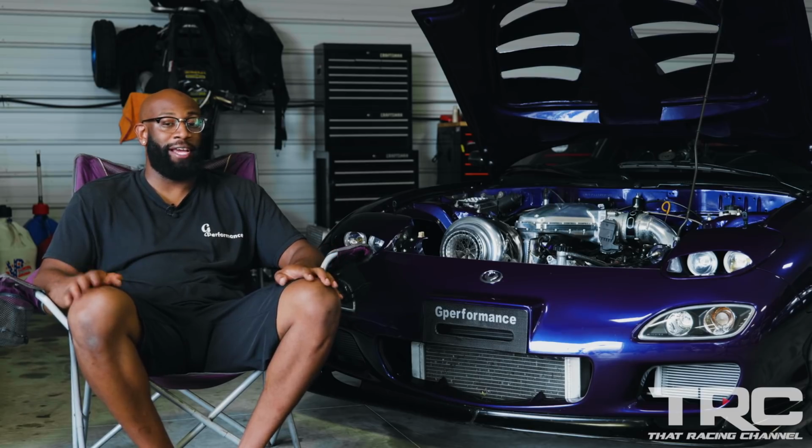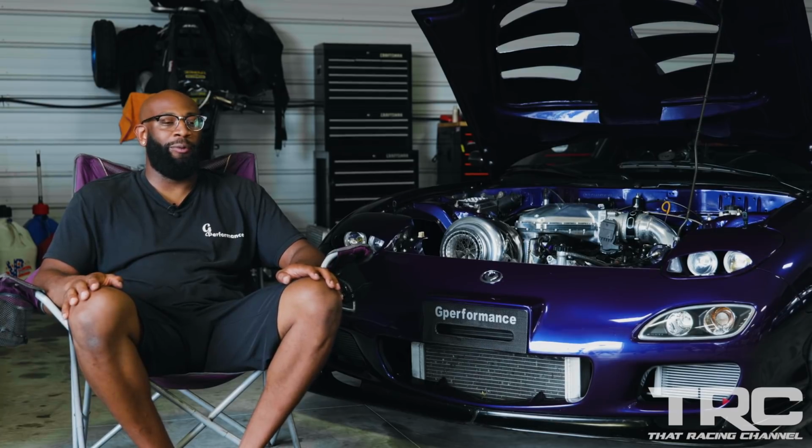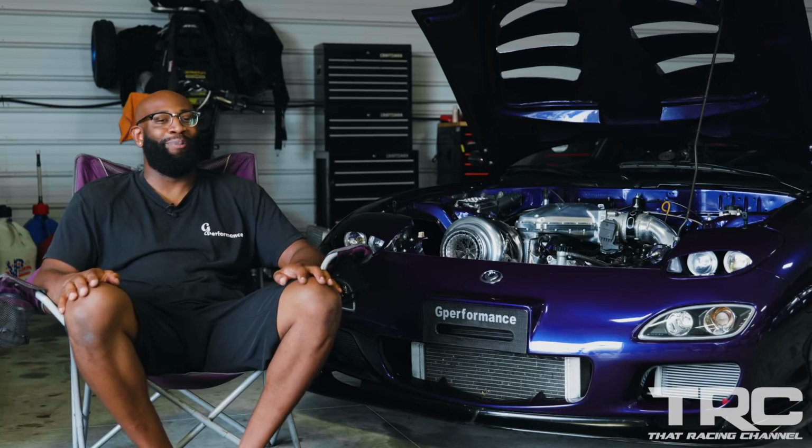I haven't been to the track yet to do any type of testing. So I'm going to see how they do on the track, see if it gets me where I want to be. If not, then I might go down in the gearing, maybe a 390, 380 something, just to see how it does. Honestly, I really wanted the car to be set up for half mile stuff. So I'm going to play around and see if it gets me to the range I want to be, because I originally set out to build a car for a half mile. I would love to hit 200 in the half mile and see if it can make it there. But it's just trial and error at this point.